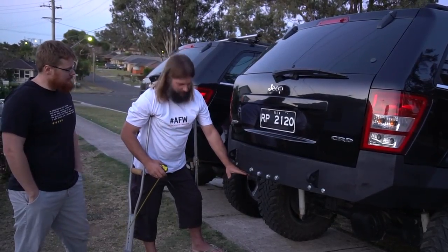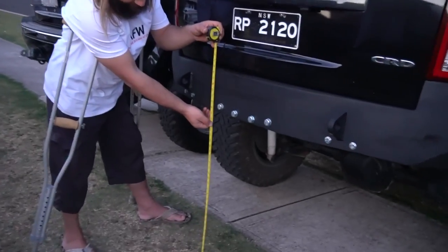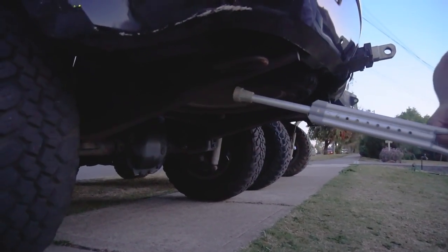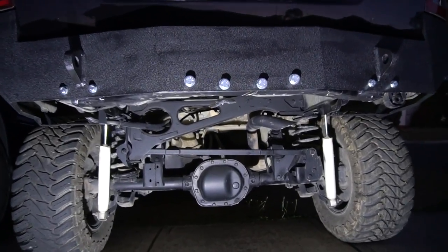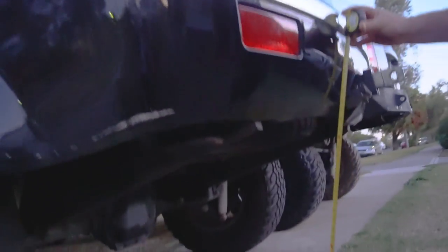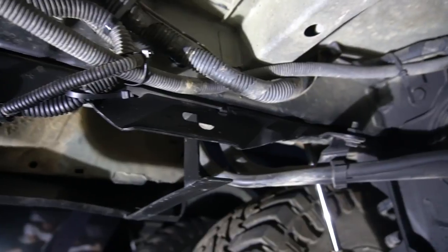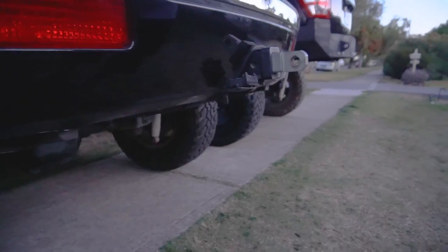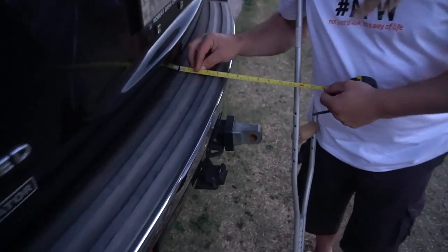As you can see, this is the size of the ledge he could now drop off from when off-roading and descending down rocks — that's a good 31 inches of height. These are the original rails under my Jeep; Jason's are all cut off now. The original plastic bumper sits at about 26 inches to the bottom, so there's about a 5-inch increase in height. Coming off a step you're going to hit the metal bar rather than ripping off the plastic.